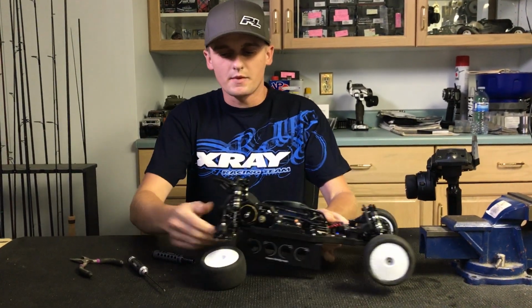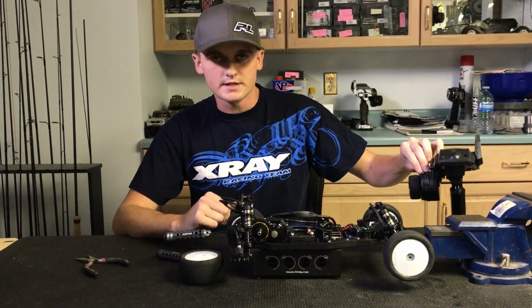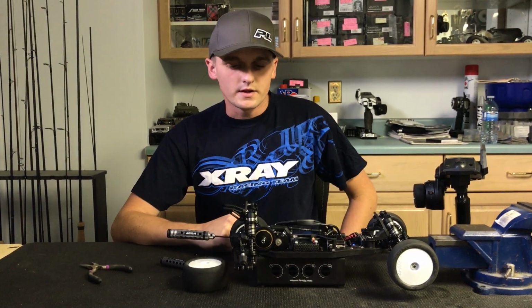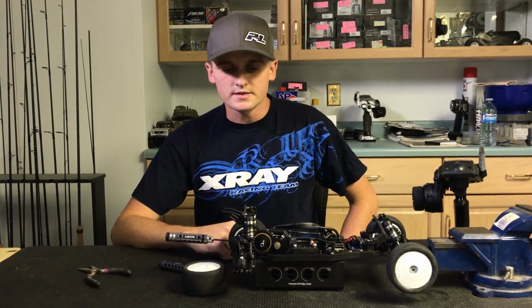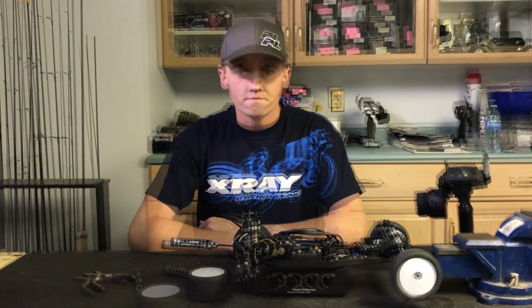And I don't need to put the tire back on, so I'll just do the same thing. I'll put the Allen wrench in the same side, and then turn the trim up a little bit more, just because it's a little bit tighter, it needs a little bit more throttle to do that. So then I'll let it sit there again for another 5 minutes. And it's better to do this slowly. You don't want to really rush it. Don't want to have it going too fast, so the balls and rings can seat together. It's going to benefit you in the long run if you take your time.